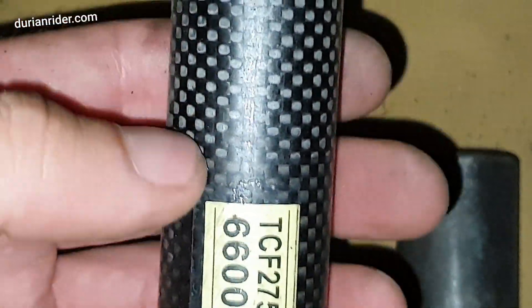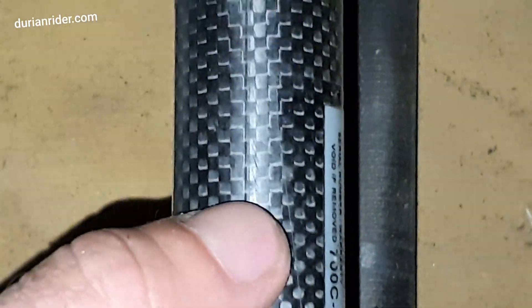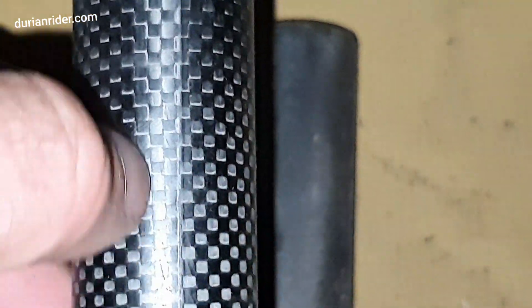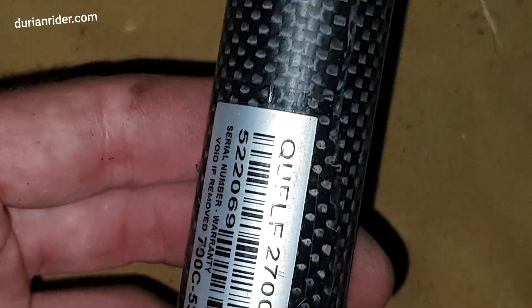Let's go with a Trek branded fork. Nicely finished, there's no ring barking. So if you've hit a big bump on your bike, what are you looking for? You're basically going to be looking for any sort of cracks or abnormalities. You'll see here there's like this — what's that abnormality? Is this a crack? Is that a big long crack in there? No, that's just a layup. You might think, oh my God, I've got a big vertical crack all the way through — no, that's just a layup. You can see it's all checkered or weird looking, like it's warping — no, it's just a layup. Carbon fiber is just sheets stuck together, laid up.